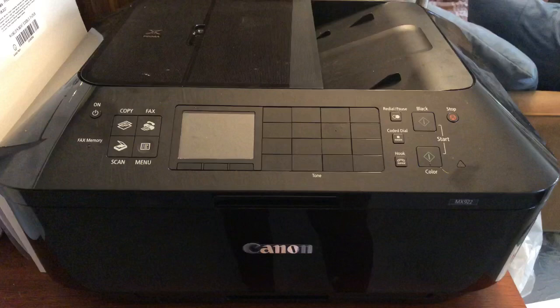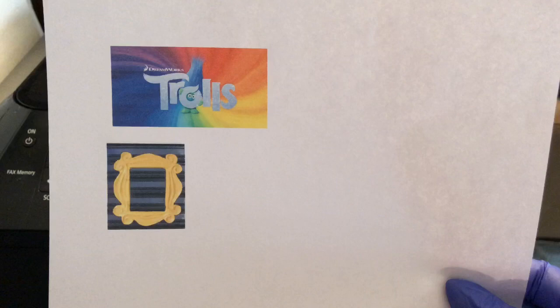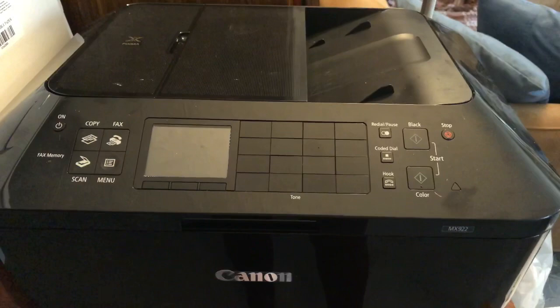I'll link below the printer that I got so you can get something similar. Let's just get into the video and I'll show you how I clear my printer head every day or every other day. I print tester pages just to make sure that the ink is running through the system and I don't have any clogs. This is what it looks like when everything is good — all the colors are vibrant. This morning I printed it and you can see the black in the picture frame has all the stripes in it, so now I know I have to clean the printer head. I have to remove the printer head and the ink cartridges, so I'm going to turn it on.